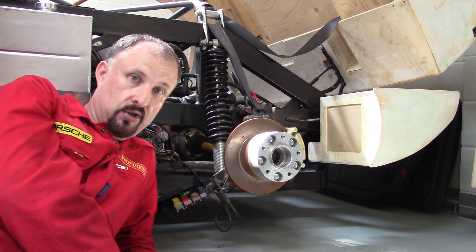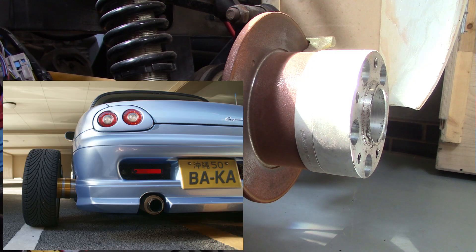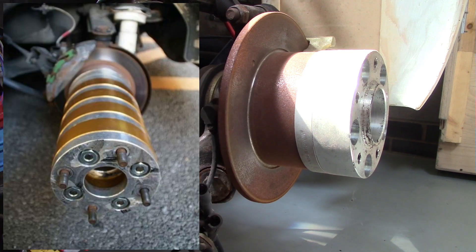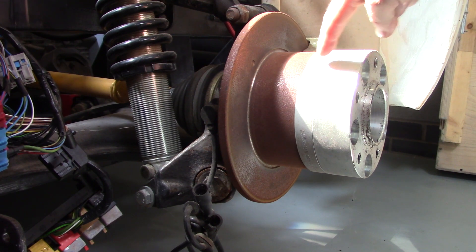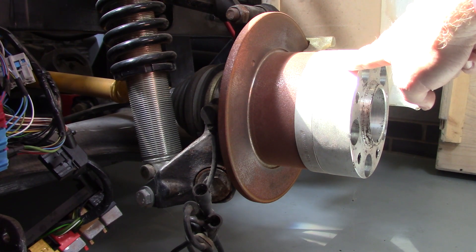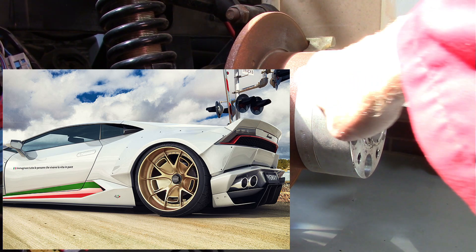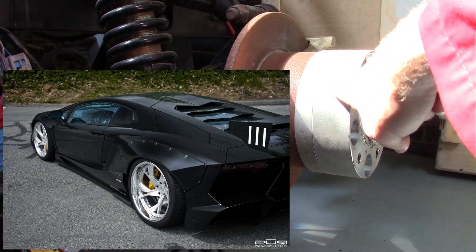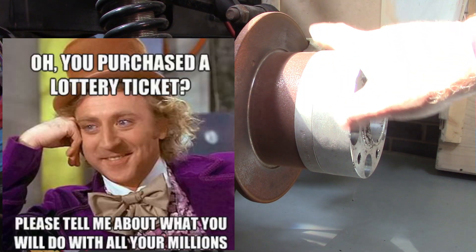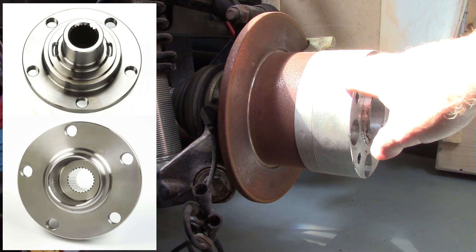Let's take a closer look at this brake setup. Before anyone says 'wow, look at the size of that wheel spacer, you're going to pull out your wheel bearings' — remember, this is the prototype. This is temporarily being used. We have a PCD converter and a wheel spacer. The rear wheels on this car are supposed to be dished; I'm just fitting BMW standard wheels, so this makes up the difference. When the proper chassis is made, we'll probably have to have machined custom hubs.